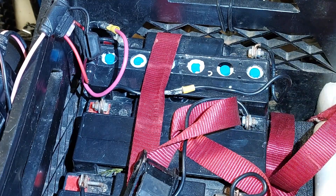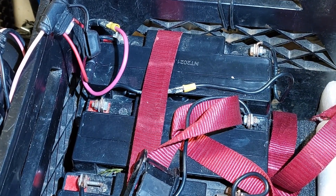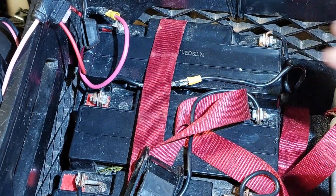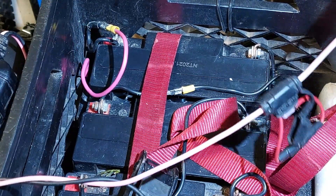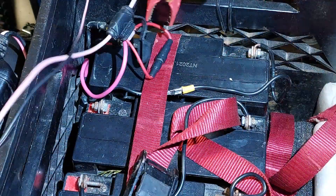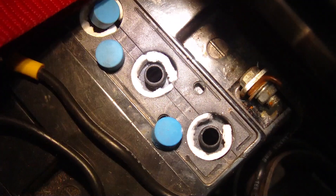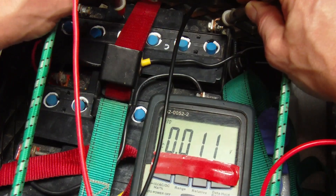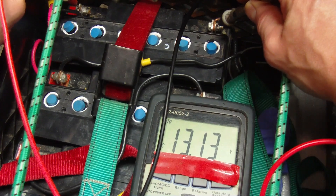Once I added the water and charged it, it started coming back to life. It was still a little dry after the first check, so I added a little more. The best approach is to add a small amount of water to each dry cell, then charge it, cycle it, and repeat — don't add too much at once. Hydrate it enough to get it working again. Now there's a little moisture in there — if I look at the fiberglass separator it has a shiny wet look. After sitting a few hours off the charger the standing voltage is 13.1 volts, so it's holding a nice charge.